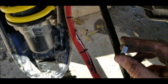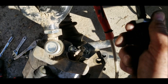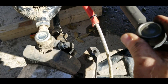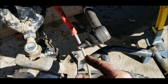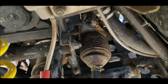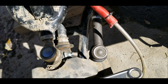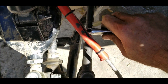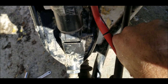Take the Toyota nut M14 by 1.5, put it back on the tie rod as the lock nut. Then take the Toyota RAV4 outer tie rod end. Before putting it in the portal bracket steering knuckle, I'll go ahead and put the lower control arm back on to make sure everything is lined up. All back in place — the whole tie rod assembly is in: inner tie rod, factory boot, clamp back on, out to the outer tie rod, right into the portal bracket. Now all you have to do is set your alignment just like you normally would, since it is just like the stock one — only threaded on one end.